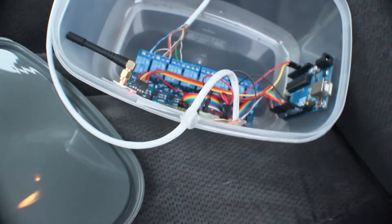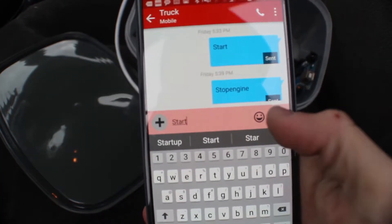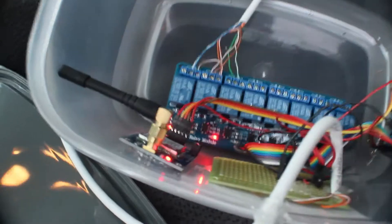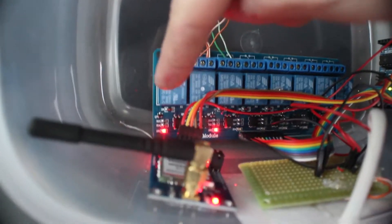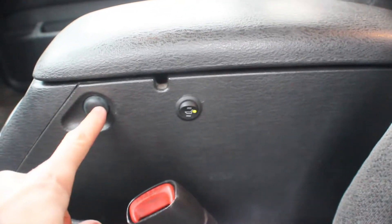Since I wired in the parking lights, let me give a little demonstration. I'm going to hit start. You can see the parking lights flashing — now it's on. Ignition's on, and it started. You can see more lights on now. We have the parking light LED and the ignition LED, which just show which relay is on.